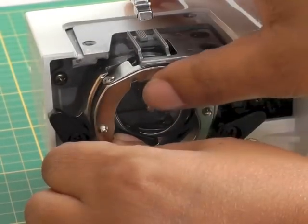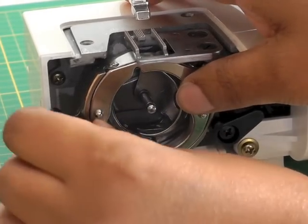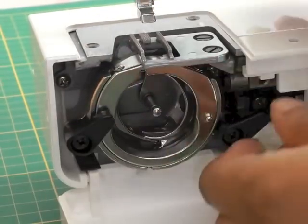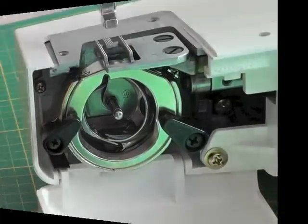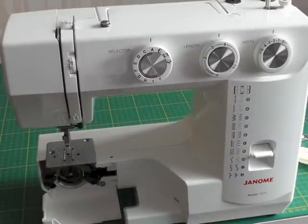It can be a little bit tricky. It should just go in just as smooth as that, and then position the little clips into place. And that's all done. Now I'm happy with the cleaning of the bobbin area and also the stitch plate.